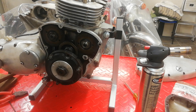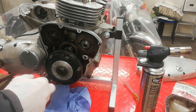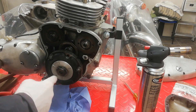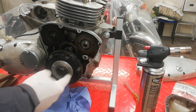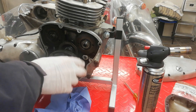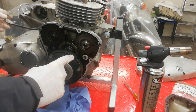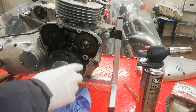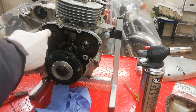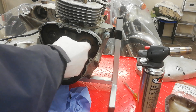There in all its glory is the timing case. This is like the alternator - that's the stator, it's got all the wires in it. And that's the rotor, which is the magnet. A rotating magnet within wires creates a current, and as it comes out that charges your battery. So that's the alternator: two separate parts, stator and rotor. And we've got the inlet cam there and the exhaust cam there.